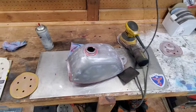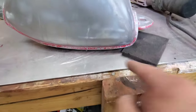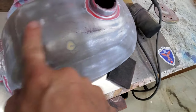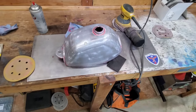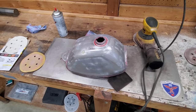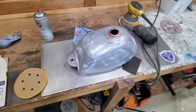We got the tank sanded down but I've noticed something — there are several little spots of bondo, and a long streak all across the bottom there. It doesn't look like there are major dents, but curious why they would have used bondo on what was a brand new tank. That red paint just does not — I don't know what it is, but it's not good paint. So I decided to take it down to pretty much bare metal, clean it off, get a coat of primer on it, and see if we need to do any more patching just to make it look nice and smooth.